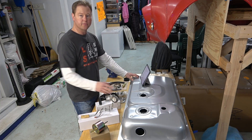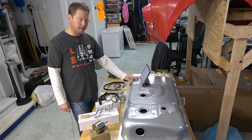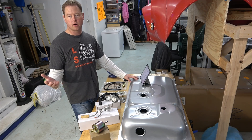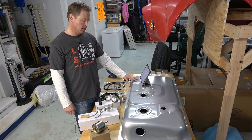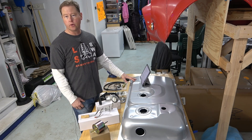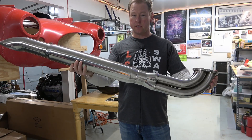This tank did not come with a fuel pump because there are so many options. You could use a traditional mechanical pump on the engine for a carbureted setup, or an inline external fuel pump for carbureted or fuel injection. I want an in-tank fuel pump, mainly for noise — don't want any noise from an external fuel pump.